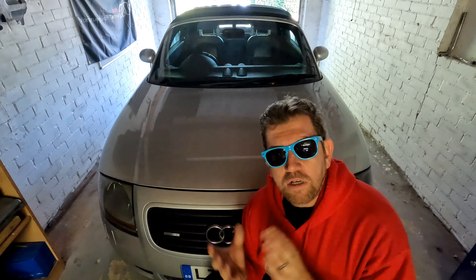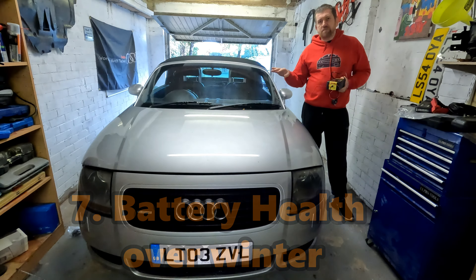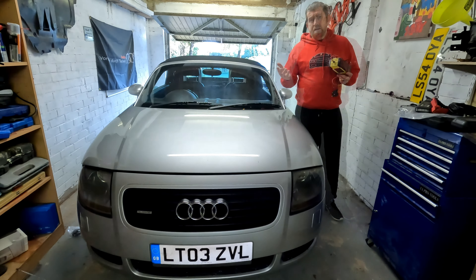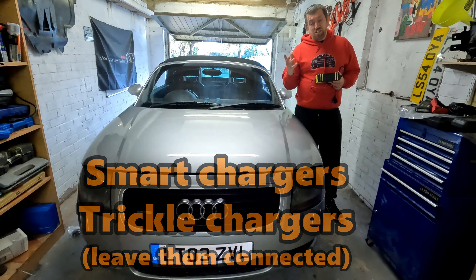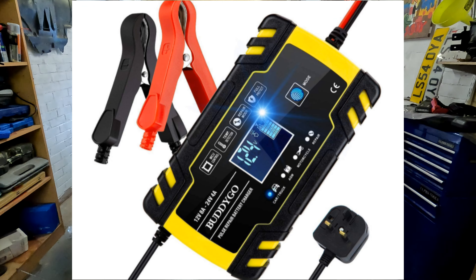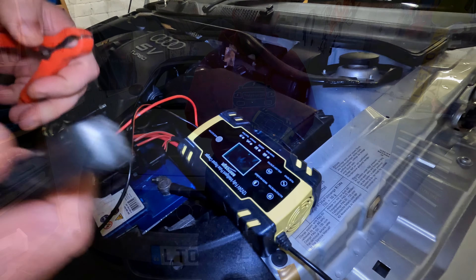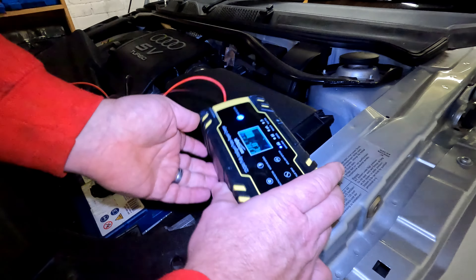The car's in the garage, it's got the chocks under the wheel so it's secure, the brakes are not on — so let's look at the steps we now do. One thing you're going to want to do over the winter is keep the battery alive. If you let the battery go completely flat and leave it, chances are it's going to be not so great in the future, so keeping the battery levels topped up to maximum capacity is essential. There are a few battery charging products out there, normally referred to as smart chargers or trickle chargers. If you connect your smart charger to the car over the winter it will ensure a constant supply of power to keep levels topped right up. The smart charger I went for is unbranded — I will try and find a link and leave it in the video description. The good thing about smart chargers is they have several settings and can also repair your battery if it has gone completely flat.